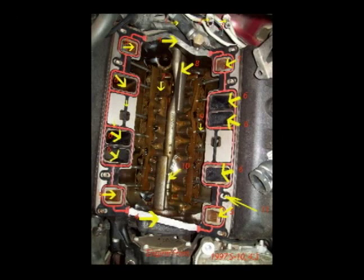This shows inside the engine. Number 1 is the oil pressure sending unit that works your gauge. Number 2 is the high pressure inlet line to the fuel injectors. Number 3 is the low pressure return line. Number 4 is where you have a gasket made of RTV, which is silicone caulk, that goes across the intake at position number 4. Number 5 shows the 4 coolant ports where the antifreeze and water mixture enters the intake manifold to preheat it. Number 6 shows all the intake ports that go into the cylinder head where the air and fuel mixture goes to be burned.